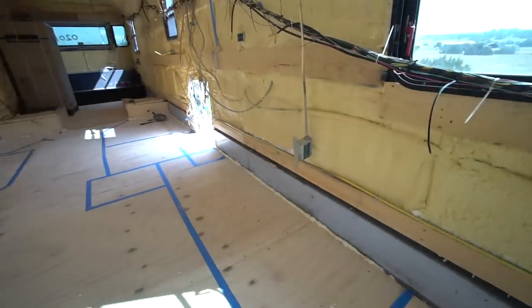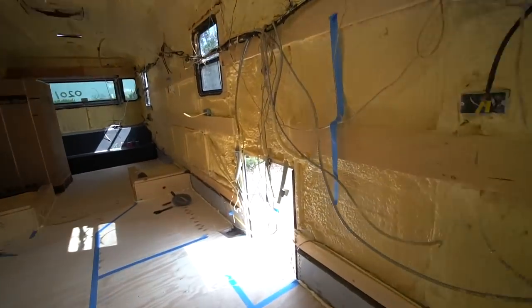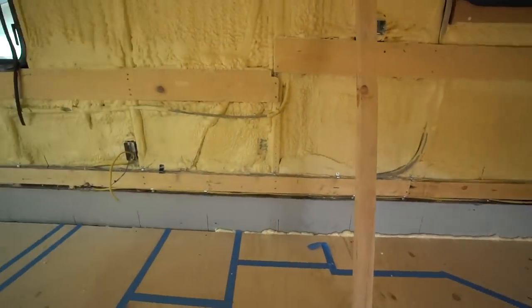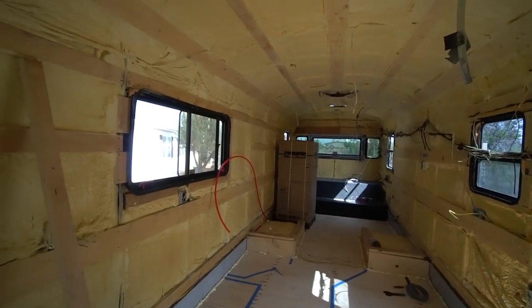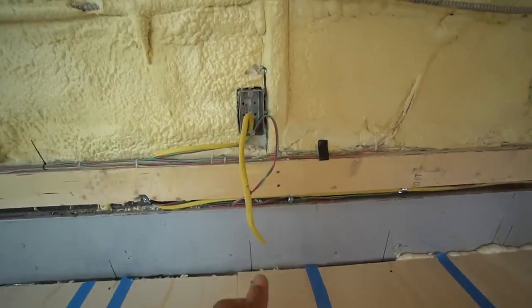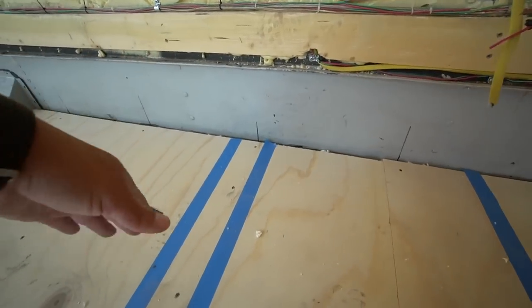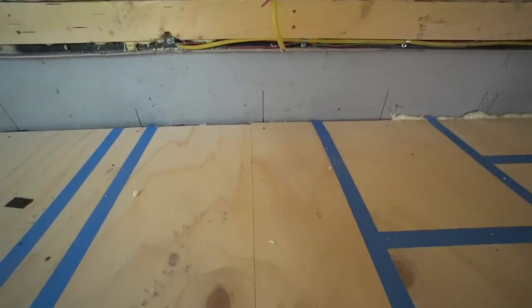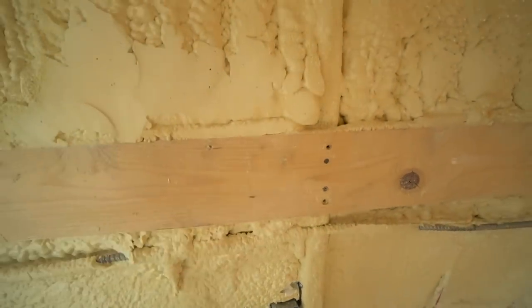I'm going to run it to the power supply, which is going to be over here in the middle — that's where all the breakers and the inverter are going to be. You can see all these wires right here; basically everything from the bus is leading to this point. Right now I'm just going through and double-checking all the wiring. The 10.1 cubic foot refrigerator is going to go right here. I'm thinking about installing a 12-volt fan system for that as well, since you're supposed to have airflow on both sides. This area is going to be a pantry space and a divider from the desk, with vents underneath and computer fans to push air through and allow cool air from the floor to run along the back of the fridge. I believe all the wiring is done.